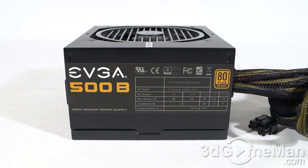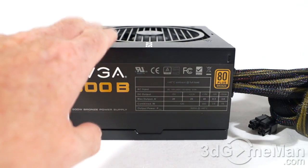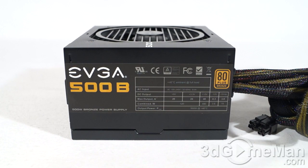There are a number of important things to remember when selecting a power supply — things you really want to know before purchasing, otherwise you could end up with a power supply you're not happy with. The first is wattage: you need to determine how much wattage you'll require based on the amount of hardware you'll be installing. Generally speaking, a medium to high-end gaming rig would require a 500 to 700-watt power supply, making this a perfect option for that.